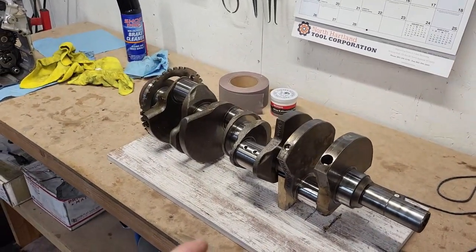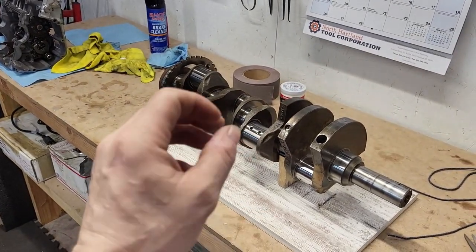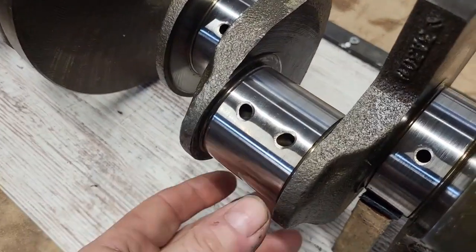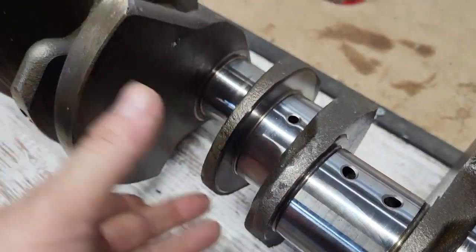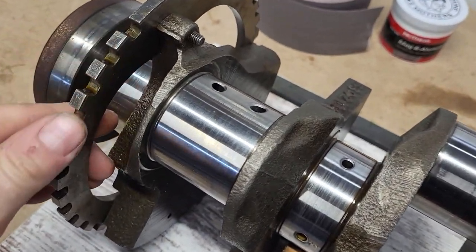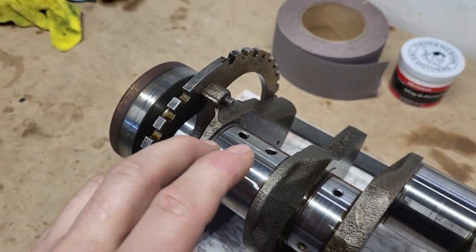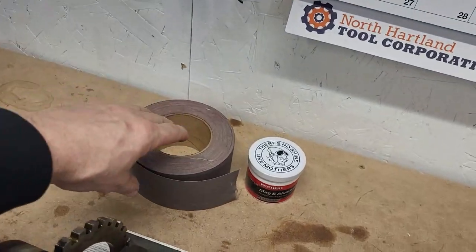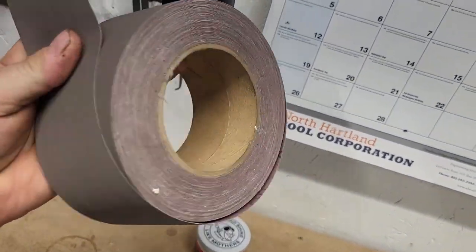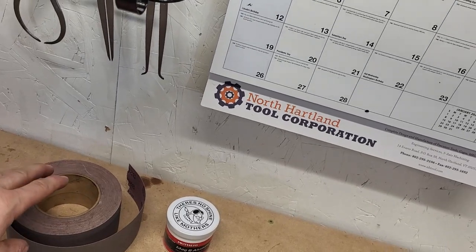Real simple supplies — it's just a little bit of time and effort. All we need is very, very fine emery paper. You just get the stuff in rolls, tear off what you need. I wouldn't suggest anything coarser than 400 grit. Then the polish — this is all I use: Mother's Mag and Aluminum Polish. Nothing fancy. We're not looking for super heavy abrasives, we're just going to be cleaning up the surface and making it that mirror glass chrome finish. Also a little chemical brush — you can get a pack of 50 at Harbor Freight for like 3 bucks. Disposable, use them and toss them.